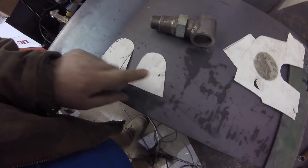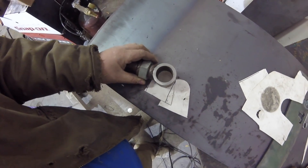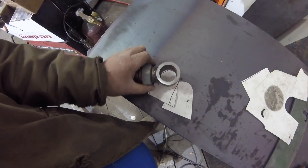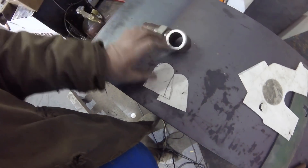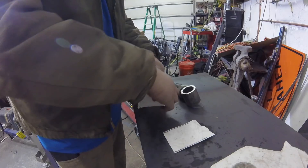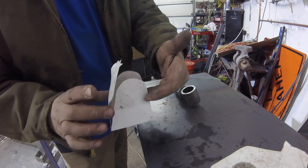I'm making the bracket for the top of the rear end. I just made two tabs — as you can see, that's how that will mount on there. The final design, the tab is actually about a half-inch, quarter-inch longer than that, so it'll sit up a little higher so I can get more of a pivot on it before it hits the pumpkin. I've got a piece for the backer, so these will run like this and there'll be a backing piece on it. Cutting out three pieces. This is not really plasma cutting work — this is more cut-off wheel work. Not as fun, but whatever.